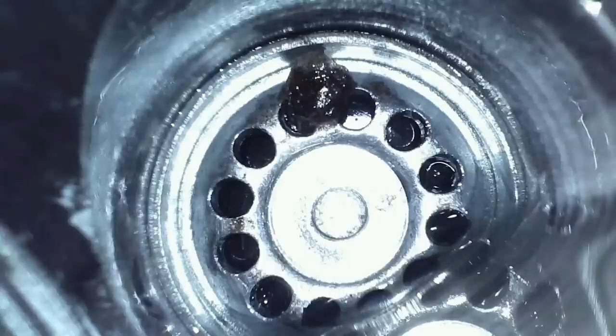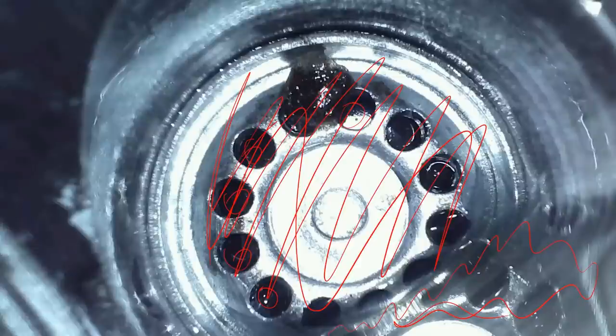We fixed this thing with a pocket screwdriver, a little brake cleaner, and an air nozzle — zero cost. As far as the algae goes, it only grew in that location. I used an inspection camera and went in the tank — nothing in there, tank looks great. How did the algae grow there? In my opinion, when the engine shuts off, the check valve closes trapping fuel from that side up to the engine, but it lets fuel drain back to the tank — leaving that spot exposed to air. It's the only spot I had algae. Crazy stuff.